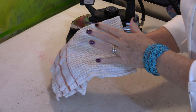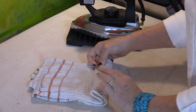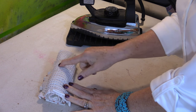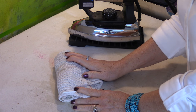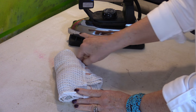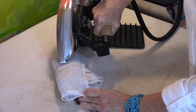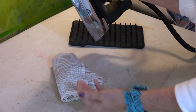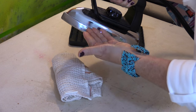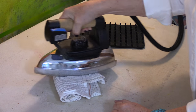The first thing I try is a cotton cloth with water. This is just an old cloth that is nice and wet. I roll it and then run the iron along that wet edge. Be sure to always test before you use any product or even just water — use the side of the iron and run it along the edge so you'll know if any damage is done and you're not damaging the soleplate. Then I just run it right along that cloth.